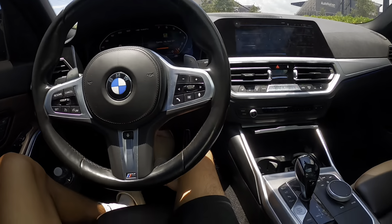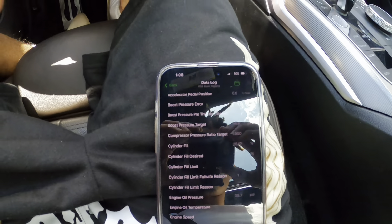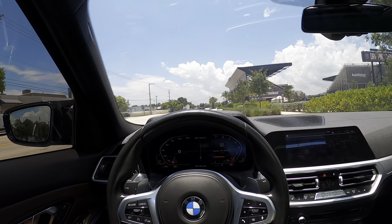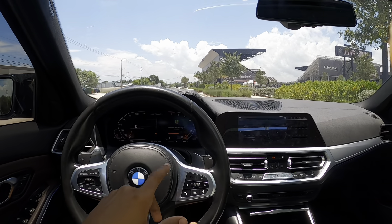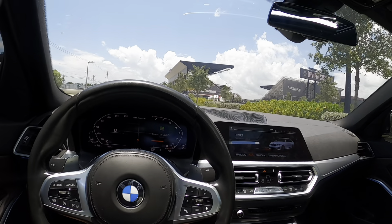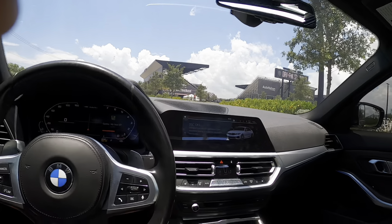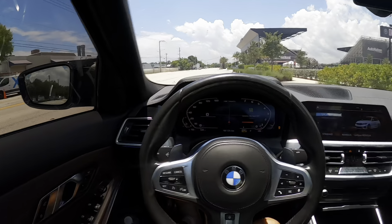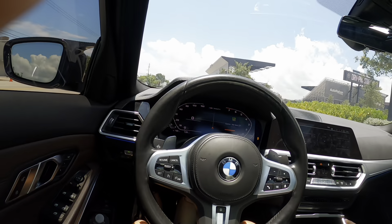All right, what's going on Fast Life family — now we're about to start our logging. I'm supposed to do it in sport mode with traction all the way off, and do a third gear and fourth gear pull. I'm going to do third gear because this road looks long enough. Third gear from 3,000 RPM to 6,500 RPM. This is my first time putting the car in sport at all, I've just been driving normally. DSC is fully off, in manual mode — once I get to third gear I start the log, then stop and send it over to him.